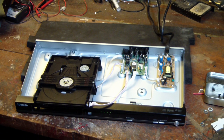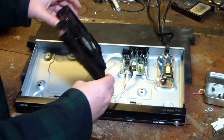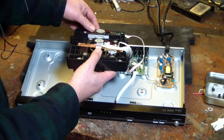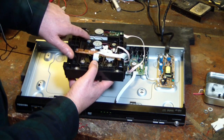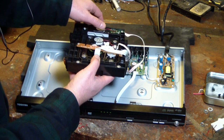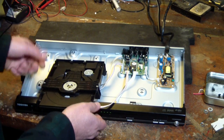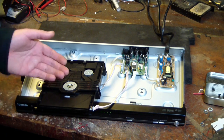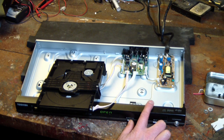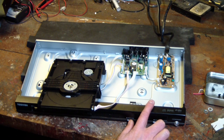I didn't have any silicone grease handy, but another thing that'll work on these plastics — what's important here is these channels where the tray is lifted. These channels were very dry. They would have been lightly lubricated at the factory, and when they dry out you've got plastic rubbing on plastic. There's enough friction there that it was binding and the motor was not able to push the tray up or lift the tray away and eject. But now with just a couple of drops of lubrication, it has no problem at all getting past that bind point where it lifts the tray.